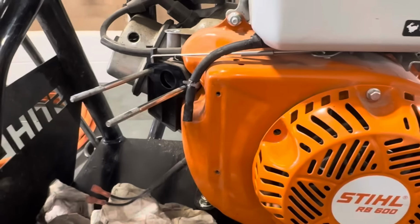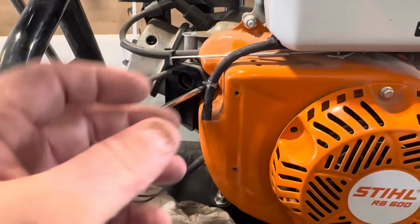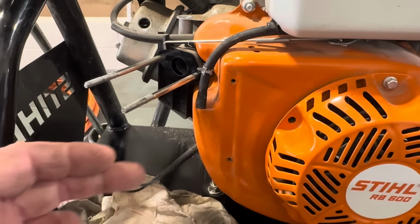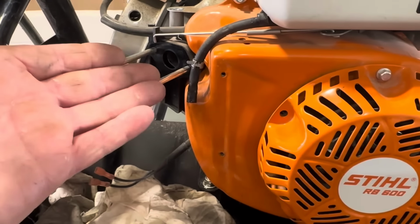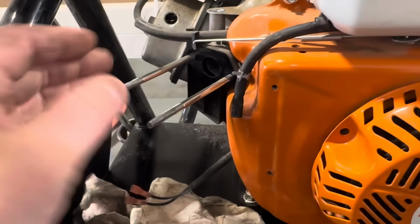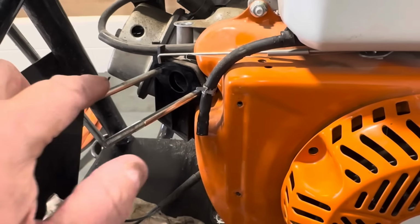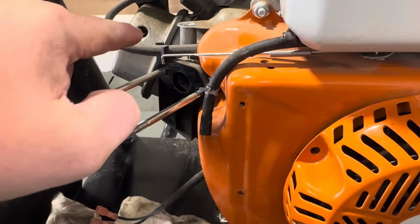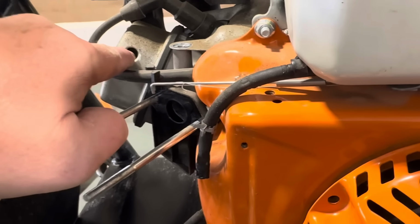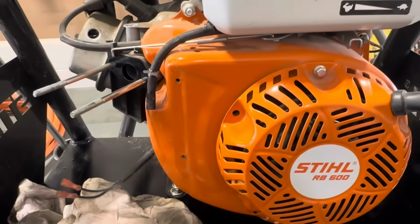The needle in the seat in the carburetor is not sealing, and so it just flows the gas right down into the cylinder, and once that gets filled up, it fills the air filter up, your air horn, and then the gas rises and it flows right down the PCV tube or the vent tube right into the engine, so it fills the crankcase up with fuel.